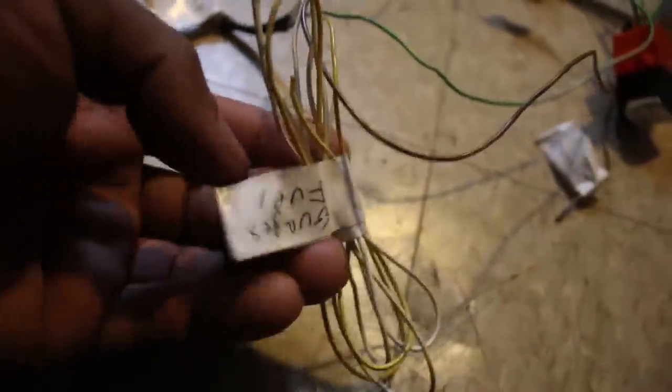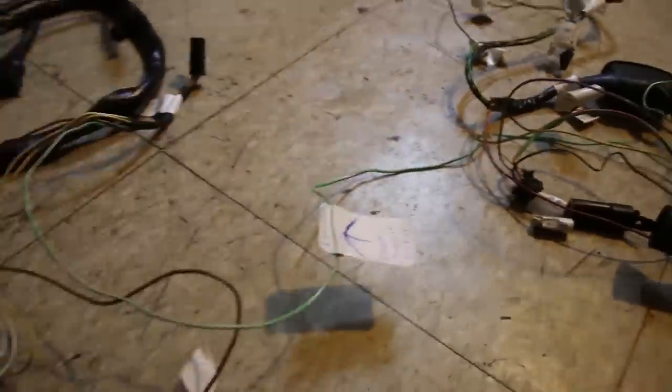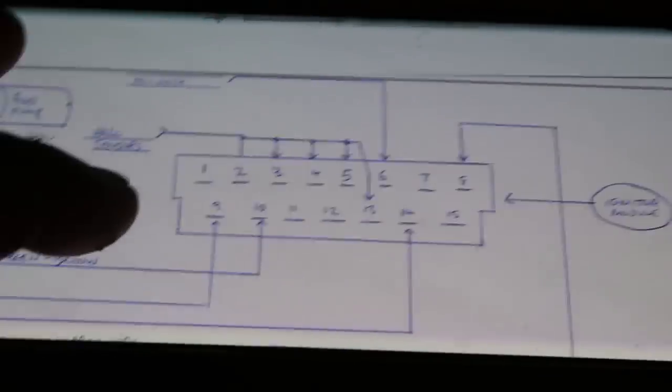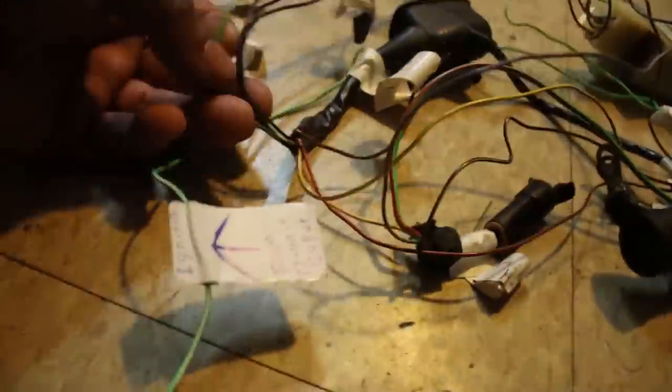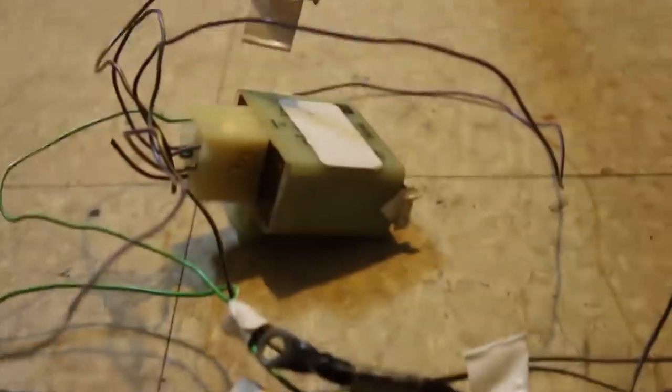The M-Unit is a more rare direction for K-bikes, but I think it's worthwhile — if you look at the electrical harness of a K-bike it's absolute madness, to the point where the relays and fuses need a totally separate ugly plastic box. There are so many interdependencies around the harness and it's definitely daunting and kind of annoying to keep around. Your options are to leave it alone — the harness does its job, it's not graceful but it works — or if you want to update the dashboard and some of the lighting, you can run the BEP 3.0 lunchbox replacement unit, which ditches the giant archaic dashboard and converts all its functions to a more modern format without getting rid of the relays.